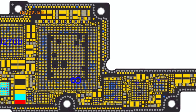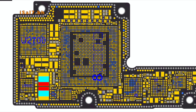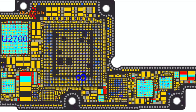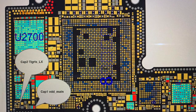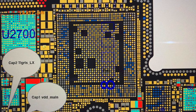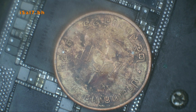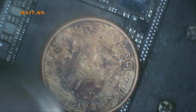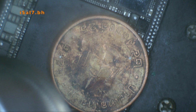As you can see from this diagram, those two coils are connected in series. There are two capacitors that you can measure continuity on — this is cap 1 and cap 2. One is VDD main and the other one is Tigris LX. If you find these two capacitors are disconnected, that means the coils are loose. In this case I found them to be disconnected, so I proceeded with removing both of them.